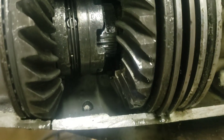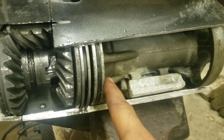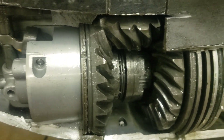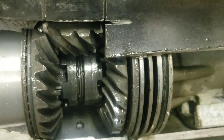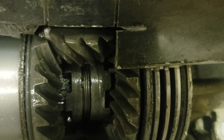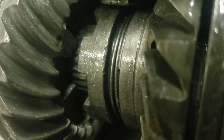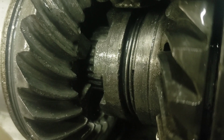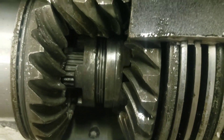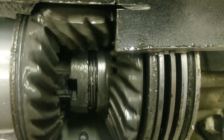I'll try to get a little better shot here of the clutches. If you noticed, the prop shaft will run all the way through — it's splined. That's where the clutches slide onto the prop shaft. It runs all the way into the back with a bearing. So that shaft is not connected to the gears in any way, it just runs through the middle of them. But when you shift it, there's teeth on the inside — you can't really see them — but them clutch dogs grab teeth on the inside of these gears. And when they grab them teeth and the clutch dogs start spinning, it in turn spins the drive shaft.